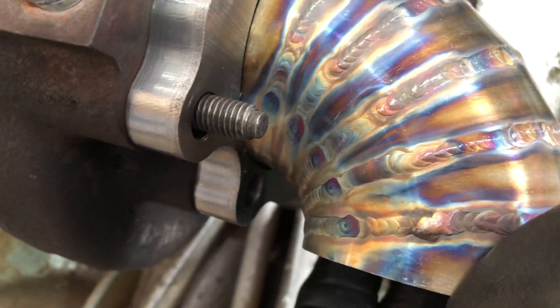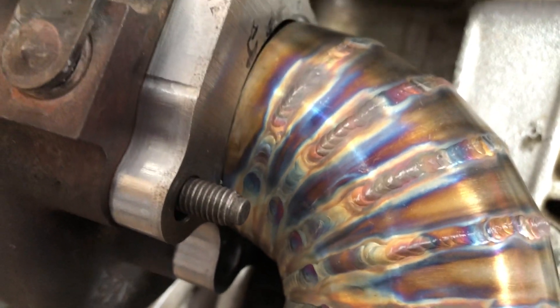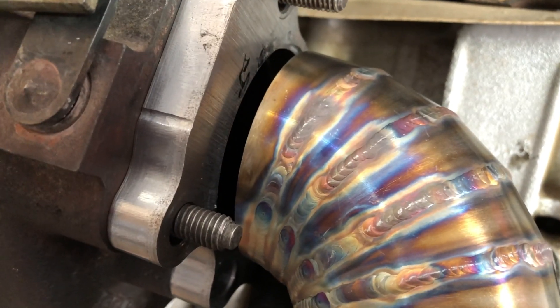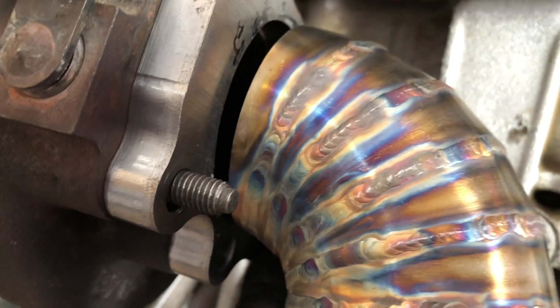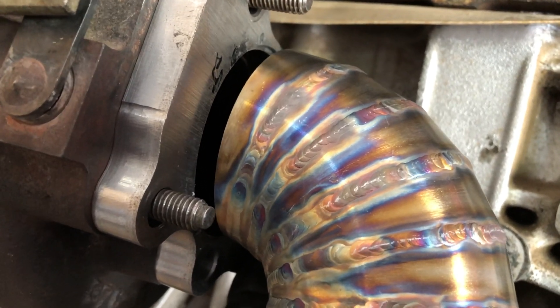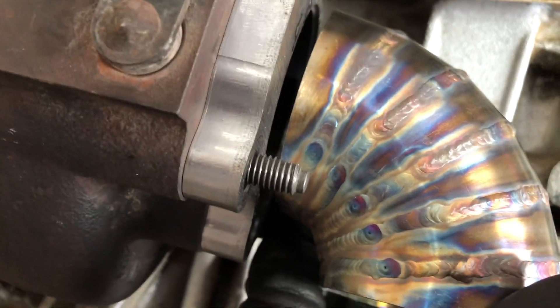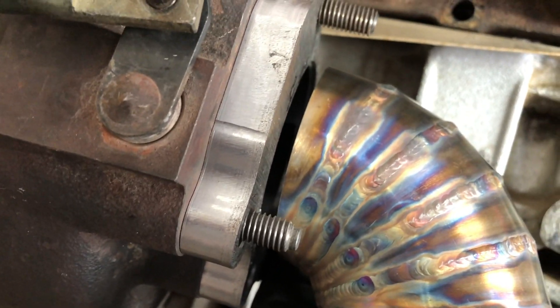The reason for the flattened pie cut at the bottom is because this flange has a mounting hole that is far too close to the actual tube. To remedy that, I flattened it out a little bit. I didn't want to go with something smaller in diameter — I wanted it to be two and a half throughout — so I did have to flatten that a bit. We'll see how it works out.